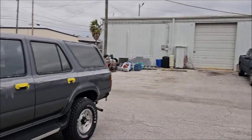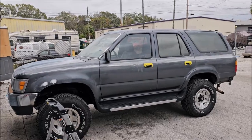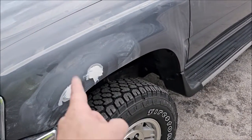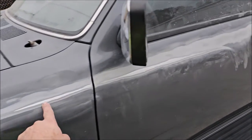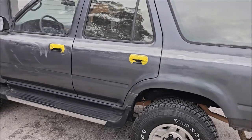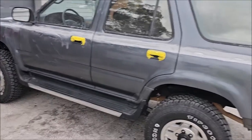Because I paint inside my shop, I do not sand in there, so I did all the majority of the sanding just a bit ago. I stripped and puttied a couple of small dings on this fender, and I had to hand sand this decal off because it was literally baked into the paint. I removed it with 80 grit.